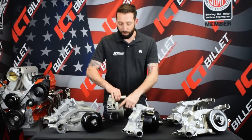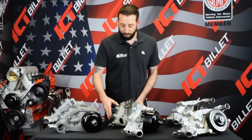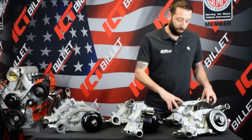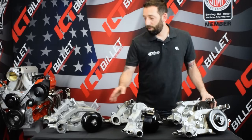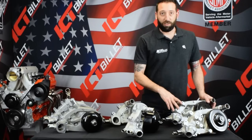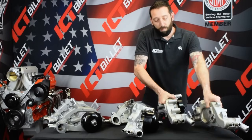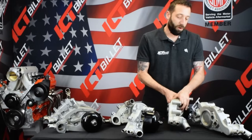Here's the Corvette LS2 water pump. You'll notice the pulley is really narrow, so there's only one belt area you'll be able to use and that's for the Corvette spacing. The mounting height here is a little bit different than any of the other pumps — not the same as the truck nor the same as the LS3. The LS3 here is a 2010 to 2015 Camaro. Still the same belt spacing as the trucks, so they're interchangeable there. But this height is about three inches from the front of the block versus one and a half inches on the truck pump, so if any accessories mount to this area it's going to throw it off. Notice this large area on the back side — all your VVT engines will work and it'll clear your timing cover.